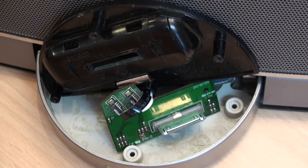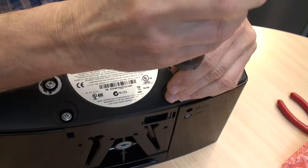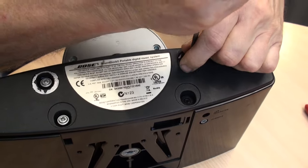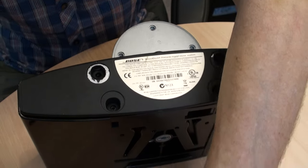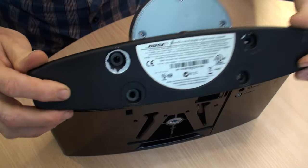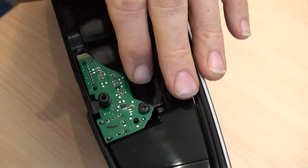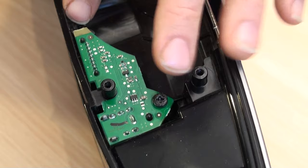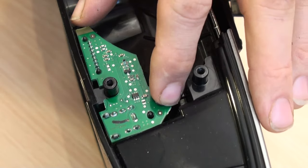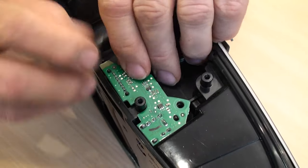Do this on a flat table so you're unlikely to lose any parts. With those three screws removed, go back to the base tray and undo all four base screws fully, then lift the plate off. This reveals the Bose PIO board that we're going to remove. There may be one or two screws locating the board — this earlier model has one screw, but if yours has two obviously remove both. Remove the screw or screws securing the PIO board.